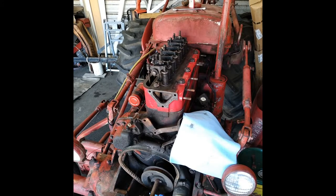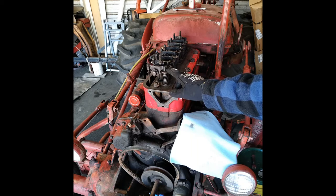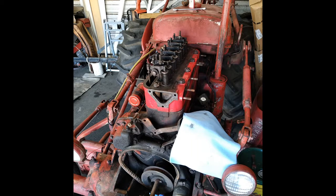If you ever have a valve that's stuck, you need to check out the tips and your pad over here on the rocker arm, make sure they're not hammered to hell. If they get too much clearance, it will hammer the rocker arm.